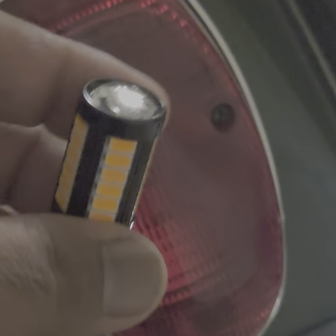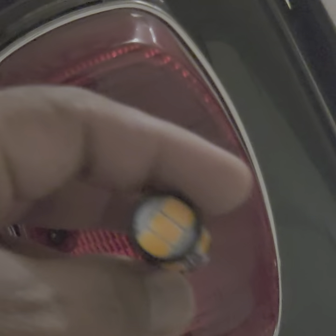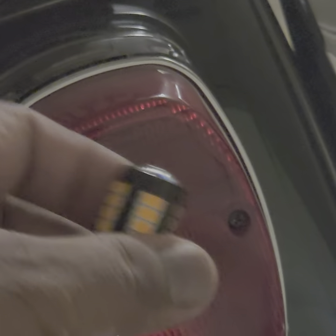I'm gonna show you how to make these LED bulbs last longer. Smaller LED bulbs with one or two diodes are not a big deal, but if you have a high-power LED bulb like this, they will get hot. On my tail light there's no holes, so the heat stays in there - no matter what the manufacturer says about heat dissipation, heat stays in there. For me it kills the diodes in about three weeks, for you maybe a couple of months, but eventually it's gonna kill them.